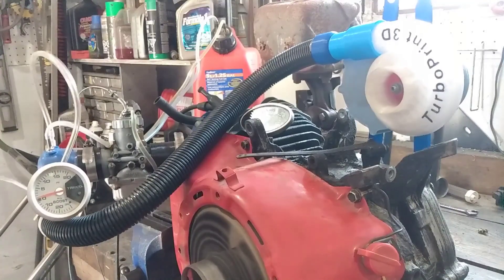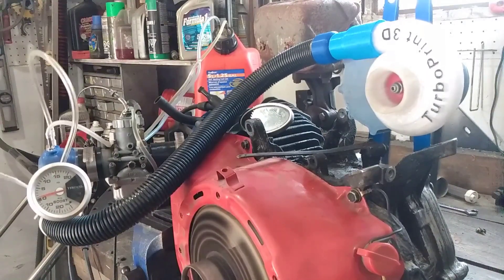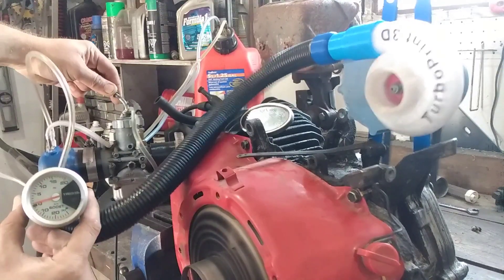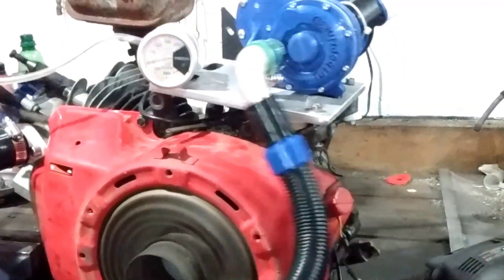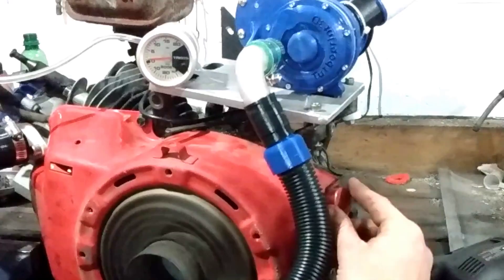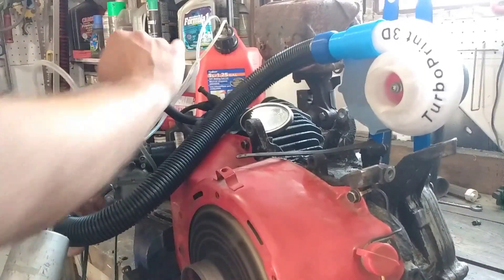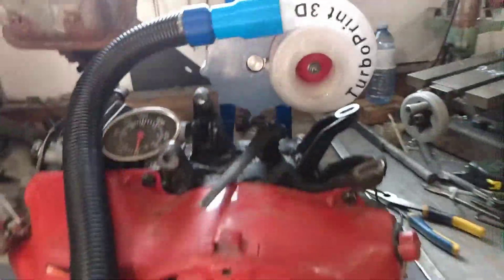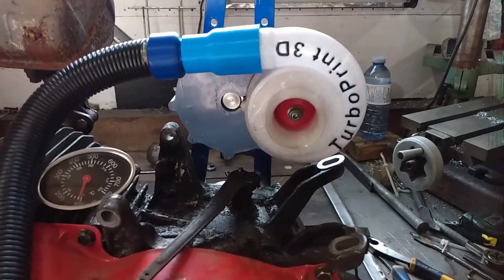With the impeller tolerance sorted out, I moved on to seeing if it produces boost and how well it flows under no load — specifically how much vacuum it pulls. If you remember from the previous supercharger design, it pulled a lot of vacuum when I cranked the throttle open, which means it was undersized for the engine. This time, the vacuum pulled in the intake was negligible. At this point I've had it running for about 20 minutes and everything seems to be holding together. Nothing seems too loose, and the gear set is making a nice consistent whine with no problems.